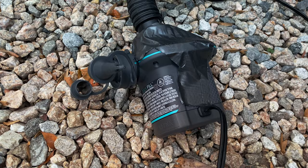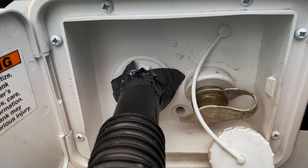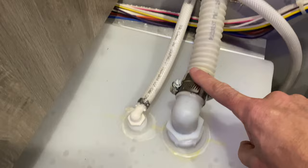The first idea was to blow some air into the tank to try and dry it out. I grabbed our air pump that we use for blow-up mattresses and attached a hose to the exhaust side to create a blower, then inserted that hose into the fill line for the water tank. There's my Intex air pump powered by my Allway power box, with the hose going into the fill line — and of course, duct tape, lots of duct tape.